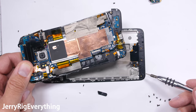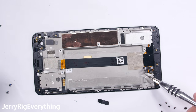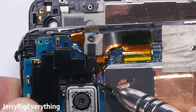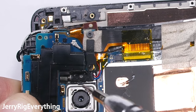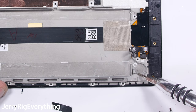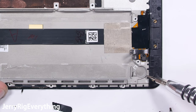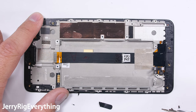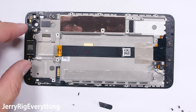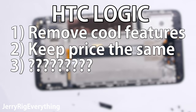The M9 even had a headphone jack at the bottom. With very little effort HTC would have had room for the headphone jack on the U Ultra. They used that circular vibrator called a linear resonant actuator — it is more efficient than the eccentric rotating mass motor in the M9, but that circular form factor leaves wasted space. Long story short, if you remove that circular vibrator, you'll have room for both a headphone jack and a rectangular rotating mass vibrator, and that's without even trying. With even a small amount of board-level changes, HTC could have stuck the headphone jack anywhere they wanted very easily. Remember, space is never the issue — money is the issue. If you remove features yet keep the price the same, you make more profit.